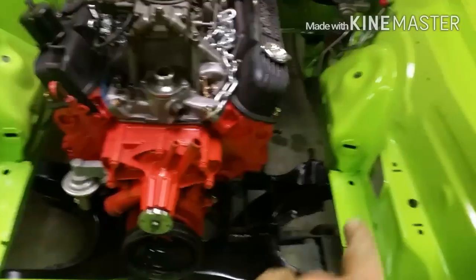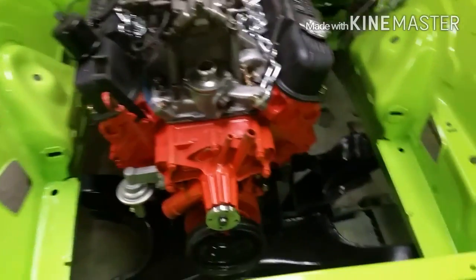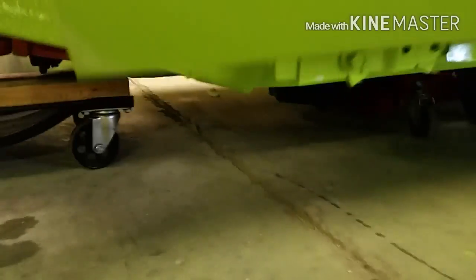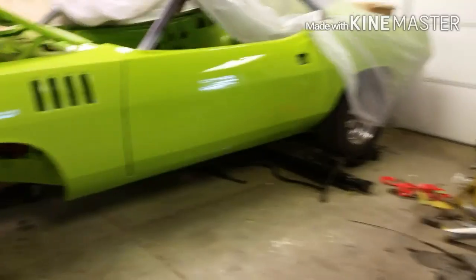Well, that's another milestone. If you've been following along, you know that this whole half of the car was non-existent a few months back. So the fact that that frame rail attaches to that K-member — the distance is right, spacing is good — didn't even have to hit it with a hammer. I'm pretty happy about that. She's in, she's bolted in. Got it sitting on a jack right now so I can lift it up. But the way the tranny's hanging, I need to get the tranny crossmember bolted in first before I lift the car back up. It's kind of tight under there, but we've done worse. At least it's clean. I didn't get my hands dirty today. But how low can you go? Low enough, I guess. Cuda on the ground, slammed. Maybe we'll leave it like that.